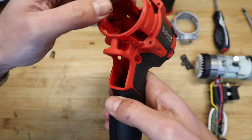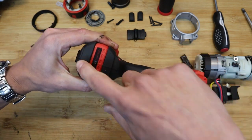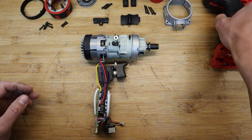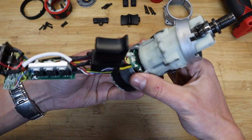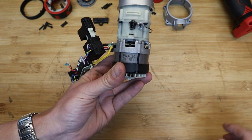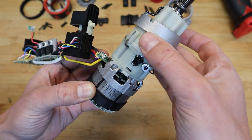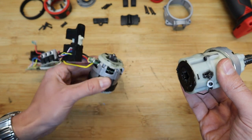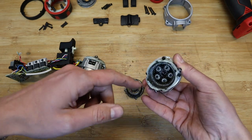The clamshell has nice flush fits — a very nicely made drill clamshell. Now let's look at the electronics. The brushless motor looks very similar to the one in the impact driver — PW4820, DC 18 volt. The gearbox is in a plastic housing, with the two halves held together by fasteners. This is the motor assembly, and this is your transmission and hammer function — the hammer feature lives in the top section.